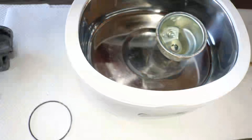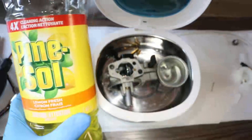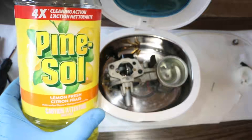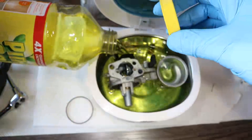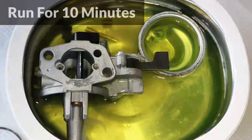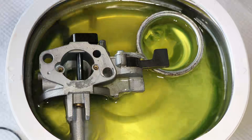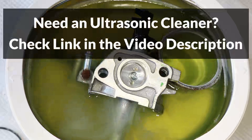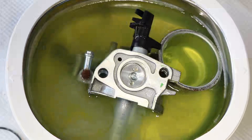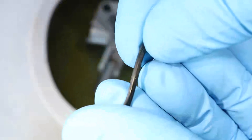So let's clean the parts with the ultrasonic cleaner and see what comes out. I'm going to use the scented pine-sol, but I recommend using original pine-sol if you can find it — I find that it cleans better than the scented one. I'm going to fill up the ultrasonic cleaner halfway with the pine-sol and the other half with water. Now I'm going to run the cleaner for 10 minutes. The pine-sol solution is starting to get cloudy, which indicates that deposits are being cleaned and coming out of the carburetor. Usually I don't clean the o-ring, but I see deposits on it, so I'm going to put it in as well. Pine-sol is safe on rubber.